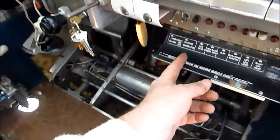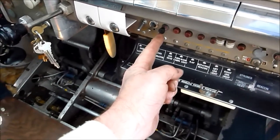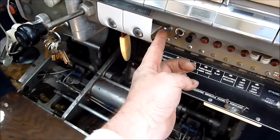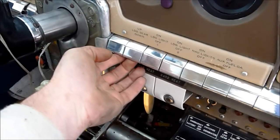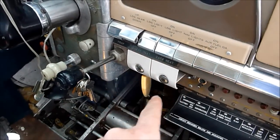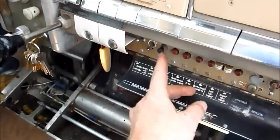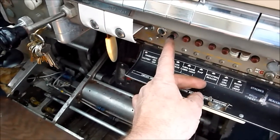The first step you want to do is locate your landing gear circuit breaker and pull that circuit breaker to the open position. Next, turn on the master and the battery. Flip the gear switch into the up position. Of course there is no gear coming up right now because we have the circuit breaker pulled. Then, after you have ensured the area is clear, begin to retract by intermittently pushing in the circuit breaker.